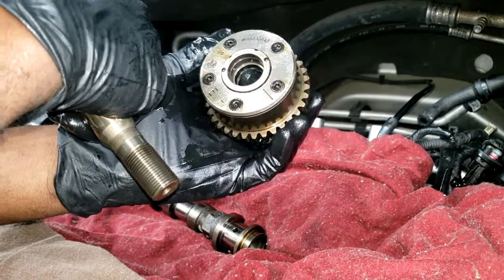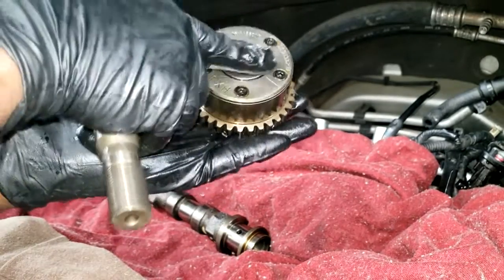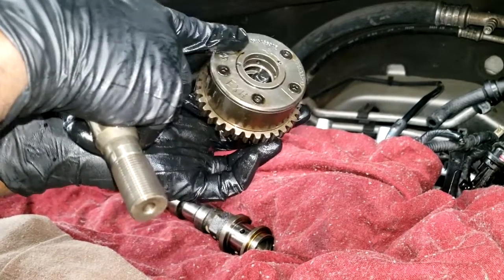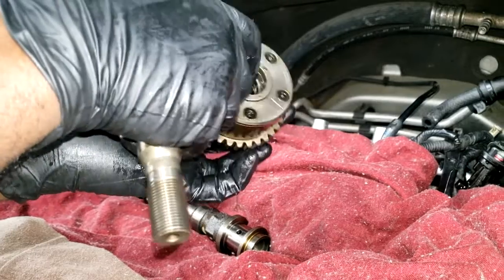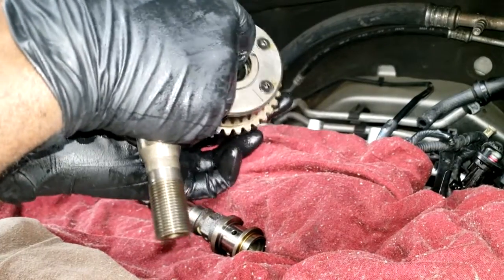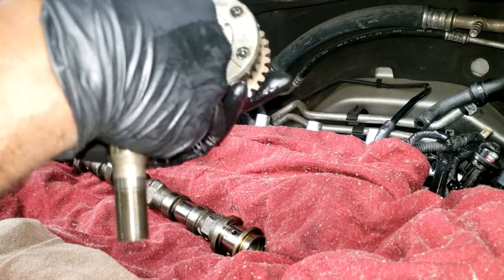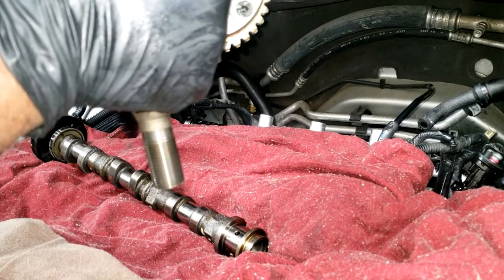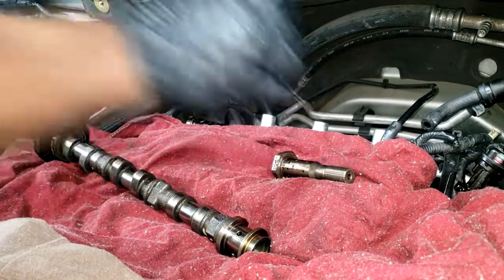All right. So keep in mind, guys. Like I say, there's no fault code that says anything bad, and there's definitely not a fault code that says cam phaser bad. You know how we tend to do with cam sensors and things like that. We see a cam sensor code, we'll automatically assume the cam sensor is bad, or the cam actuator. There's 2 actuators on each valve cover. Okay, so we got to get out of the habit of doing that, guys. We got to start diagnosing things.